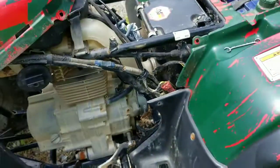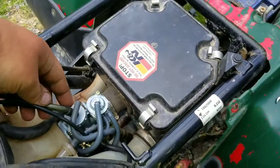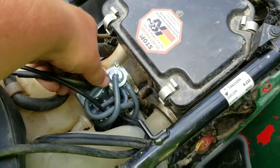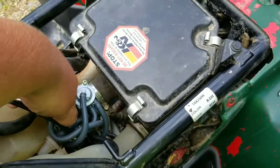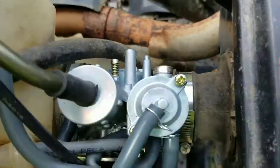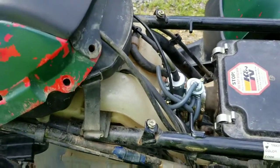This thing's awesome. I did have to make some adjustments because they sent me too long of a throttle cable — it was too long and it didn't come with the 90-degree bent angle like the old carb. What I ended up doing is cutting it off and mocking it up. Actually, I told you wrong in the beginning — this is a 27 millimeter and the original one was a 22, so that's a huge power difference. It's got all new hoses, all in there nice and tucked in. There's literally no room for my hand — I have to take everything back off and tune it. But let's go ahead and fire it up.